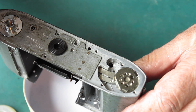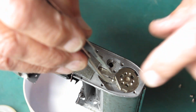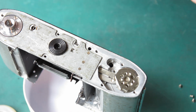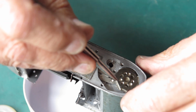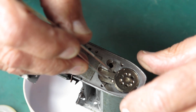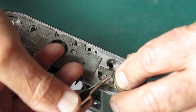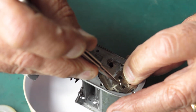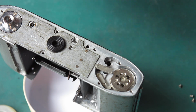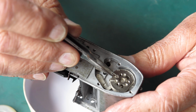would normally be here. But with the reflexes you want an extra third of a turn of tension on that advance, otherwise the advance lever doesn't return to its rest position easily. So we're actually going to want to have this around here somewhere. Pull that back out the way. I've lined up the screw holes there and put the 3 screws through.